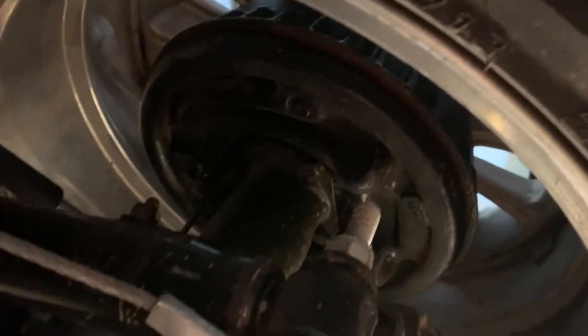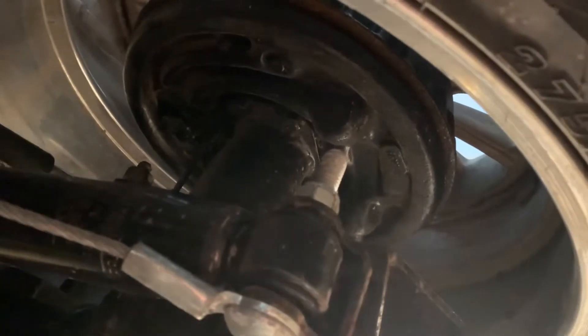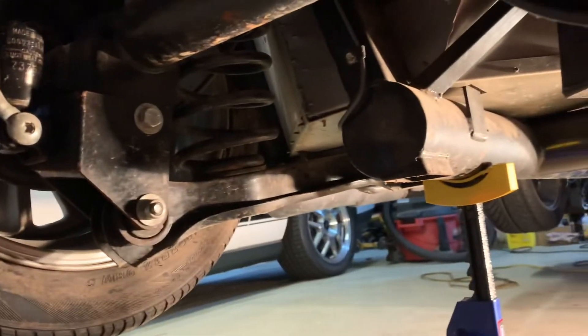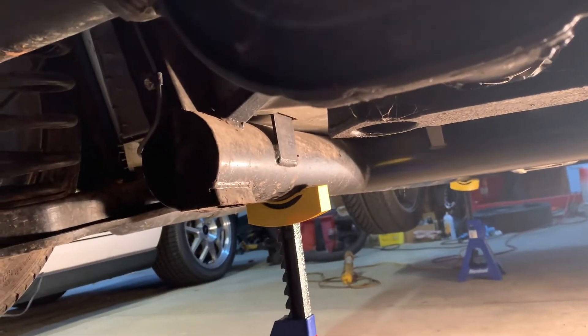Anyway, nothing too much in this video — I just wanted to give a little update. I have started ordering parts to do the brakes. Here's the passenger side — it's hard to tell because of the darkness but that wheel cylinder is leaking, so these have to be replaced. The brakes on this thing aren't exactly the safest. And the tires — they look brand new because they only have 2,000 miles on them, but they're 20 years old, so they'll probably have to get replaced pretty quickly because they're hard as a rock. Just wanted to do a quick walk-through of the underside and go over some of the things I've got going on.